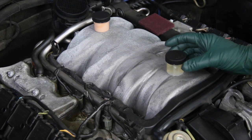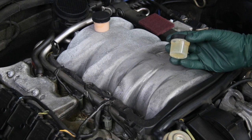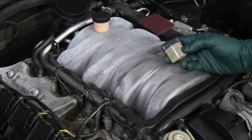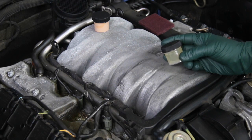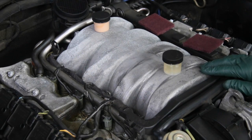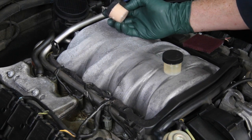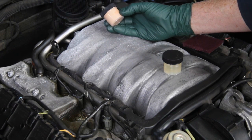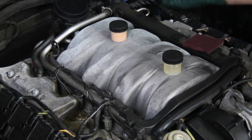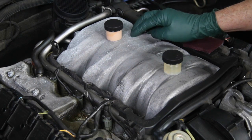Let me explain in more detail the two products I'm using on the top of this intake manifold. Number one, this is an anti-corrosive gel — it's a little bit like a grease, goes on like a grease, and leaves a little bit of a greasy film. On the rear half of the manifold, I'm going to be using what's called a metal wax. This goes on quite a bit like a cleaner wax, and you'll watch as I use a Scotch-Brite pad to scrub this metal wax into the magnesium.